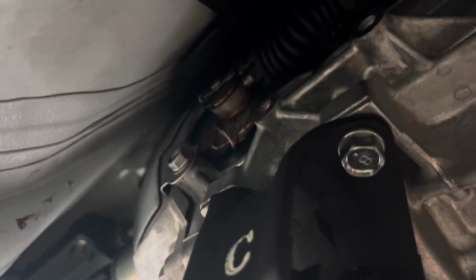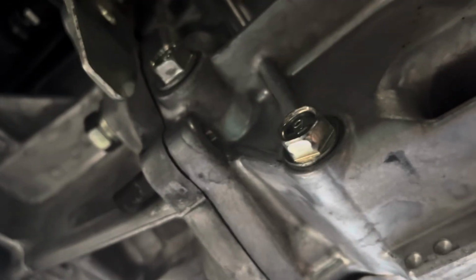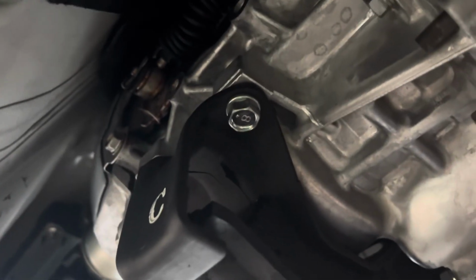I got a bunch of grease on it, so I'm gonna get a rag. But yeah, pop that guy off, take the cotter pin, take the washer. I think these are, let's see if I got a wrench that'll fit. I think these are probably 12. Yeah, so the 2 bolts up in there to take the shift cable bracket off are 12mm too. So we're gonna get that guy off, take these 2 bolts off, the other bolts above the cable there, and get ourselves some room to start taking the cover of the shifter plate off.